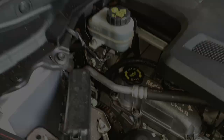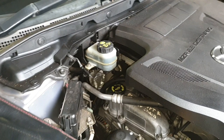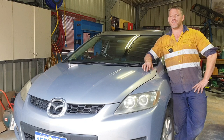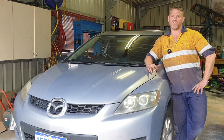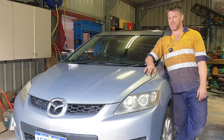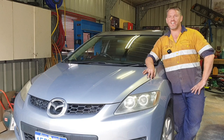Just double-checking the brake fluid level — as you can see it's pretty dirty, so I'll probably do a flush on this next. Let us know if you need a video on that. With the wheel back on, making sure the wheel nuts are tight when the wheel is back on the ground. The next stage is to bed the brakes in, which is roughly 10 applications of driving at about 50 kilometres an hour, medium brake pressure, slow down to about 10 k's an hour — do that 10 times. That's pretty much done, so take it easy for the next 200 kilometres. 30 thumbs up, thanks for watching — this is just how I do the brakes. If there are any other tips you can give others, throw it in the comments, otherwise yeah, take it easy.